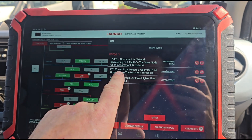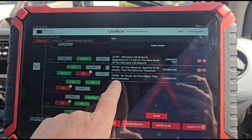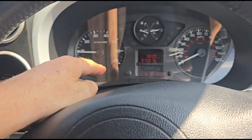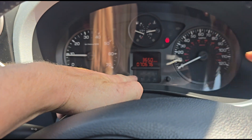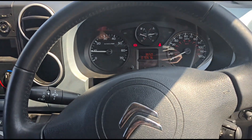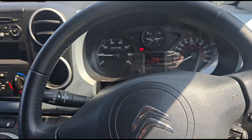This is what we're here to look at - why is the engine light coming on. We've got P0100 and a P3008, which is an airflow issue. When you floor it, the triangle light comes on - only if you floor it, first thing in the morning. And then you can hear a hissing or whistling noise, and after that it just goes out.